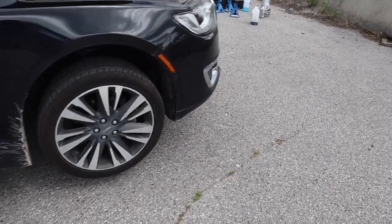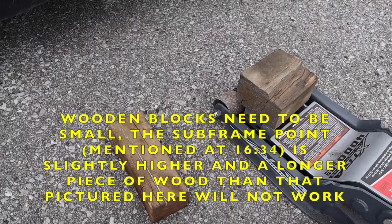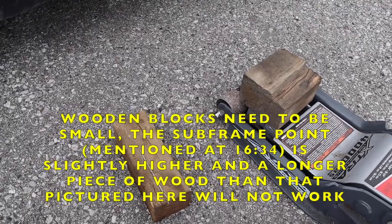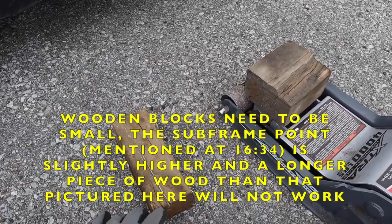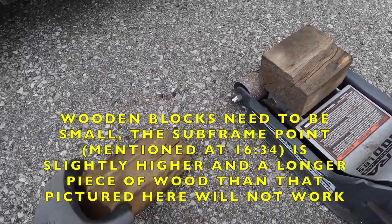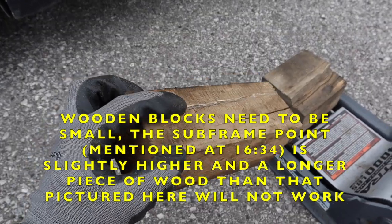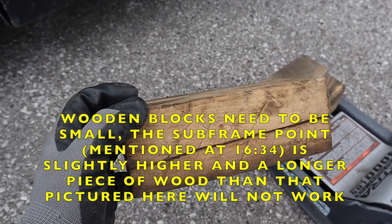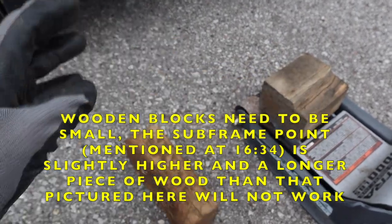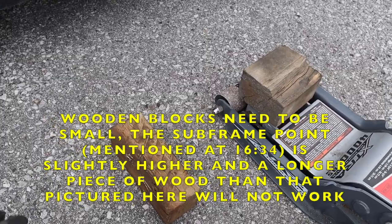All right, so the car has been safely lowered, one at a time on each side. But again, the importance of using that block of wood is fine, the one on this side, and this side lifted fine. But that bend you saw there, see this older piece of wood? That is from the car's frame rail, digging right in. So this is a low grade of wood with cracks. Gotta go find something else, and I am going to move the car.